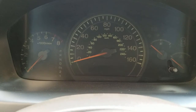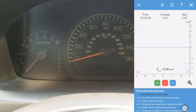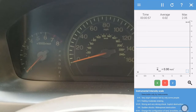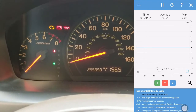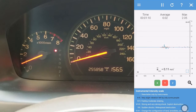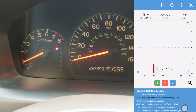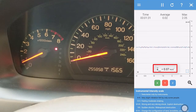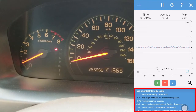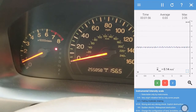I'm now going to turn on the car so that we get a sense of the degree of vibration. I'm using a vibration measurement tool so that we're objective about our observations, and this serves as a baseline to compare vibration levels after the IACV valve has been cleaned. The idle has settled at about 800 to 750 RPM. With no load applied, the vibration tool reads largely less than 0.1, moving between very slight vibration felt by only some people and detectable only by instruments.